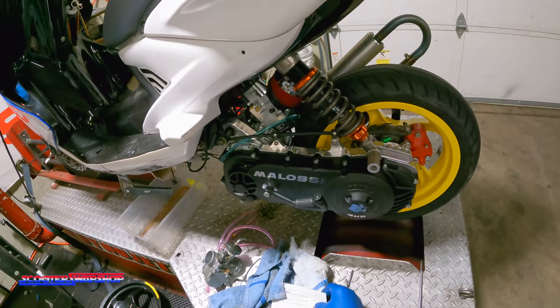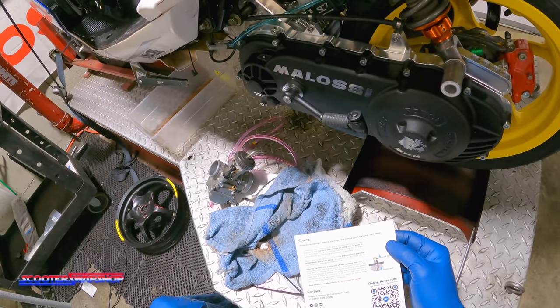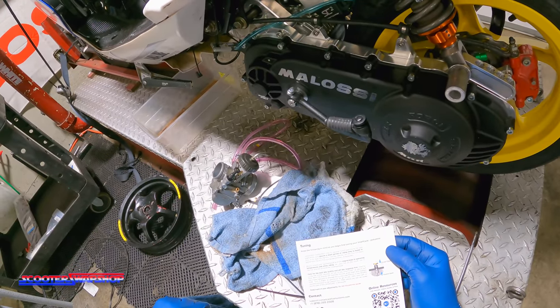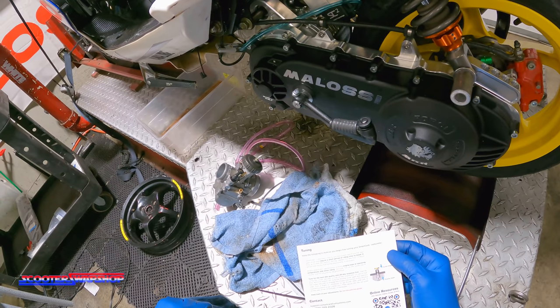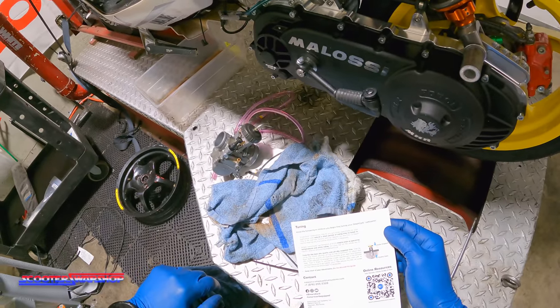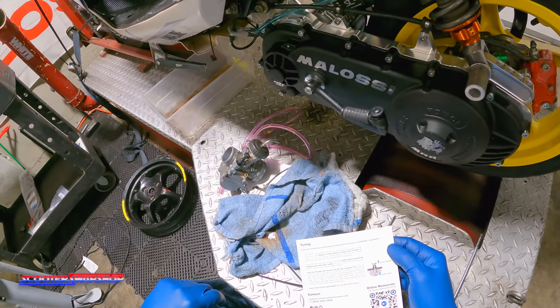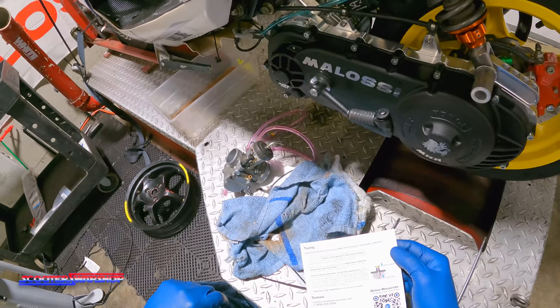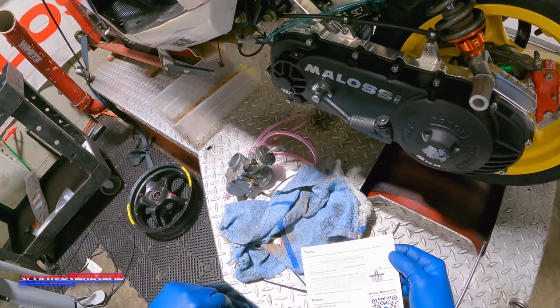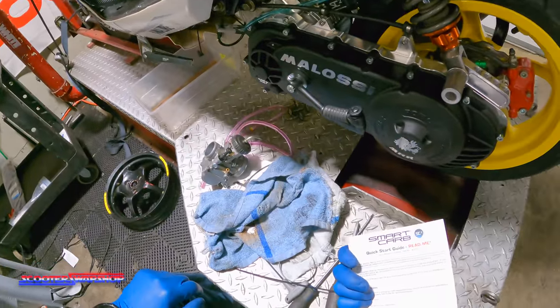Okay, now what? Start by using the clicker just atop the smart carb to adjust fuel flow. With the engine off, hold wide open throttle and depress the clicker adjuster to engage the clicker mechanism in the throttle slide. Turn it right or clockwise to go richer, left or counterclockwise to go leaner, then adjust the idle set screw on the side of the carb. That just seems way too easy.